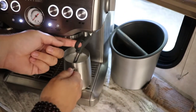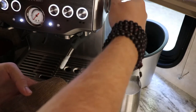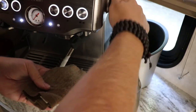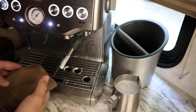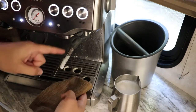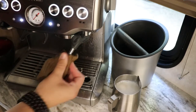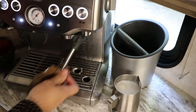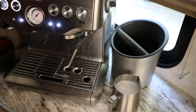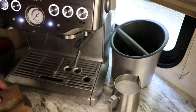Pull the wand out — you're going to notice you've got a ton of milk on it. I like to take the hot water from the americano valve and spray my rag with that first. If you immediately turn on the frother like you'd see on other high-end machines, you're going to melt the froth right onto the wand. With hot water on the rag first, you can wipe it right off. Clean the wand every single time after use or it'll start to get stuck. Then run the wand for a second on the frothing function — you'll see some milk come out, which is exactly what you want.